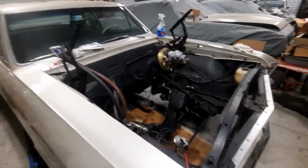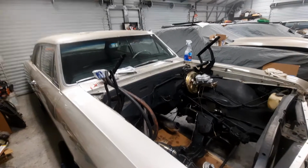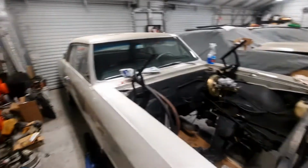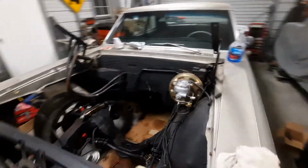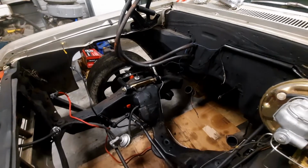So we got that. We got a rebuilt Powerglide. Harry's Transmissions hooked me up. We got a Turbo 350, spline input shaft, Turbo 350. Stall converter, 3000 RPM. We did stick the Boss 338s on this car. We did a disc brake conversion. We got a set of upper and lower control arms on it from eBay as of right now.